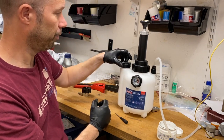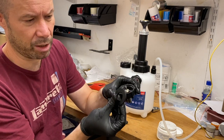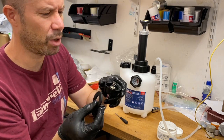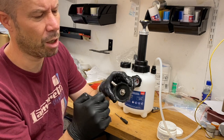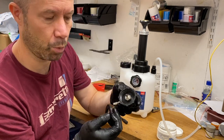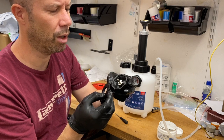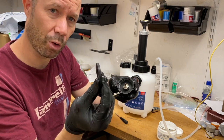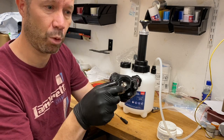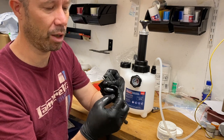The final one is the one that goes onto the brake fluid reservoir. I've already released this — it's smooth on both sides although it has a ridge in the middle. It's very thick, and one thing the other commenter mentions is that only one turn of this engages with your master cylinder, which isn't very much. The thickness of this washer is a reason for that, so if you have a problem you could potentially look at getting a thinner rubber seal — possibly from the actual cap of the master cylinder that comes with your vehicle.